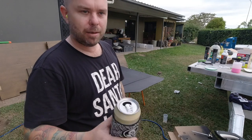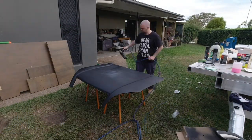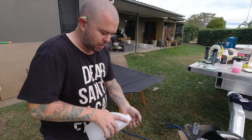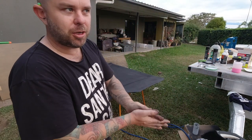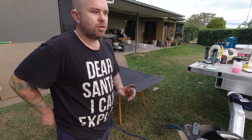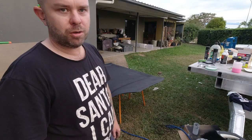It says it's got a 60-minute flash-off time, so it's now an hour later — had a couple of beers. Trying a second coat. Washing your hands in acetone lets you know where any little cuts are. So it's on — two coats, a little bit thicker than I would have liked. It says you don't have to thin it, but I would have thinned it. If you want a fine texture, you need a urethane thinners — I've only got enamel thinners. That's what I'll do next time.